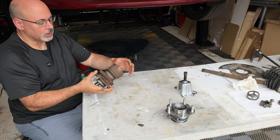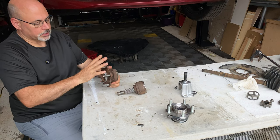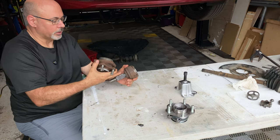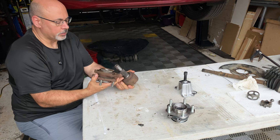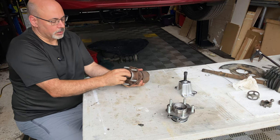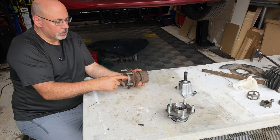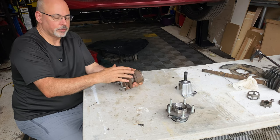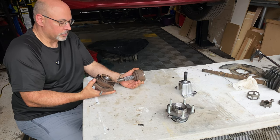This is a part I've cleaned up. The wheel bearing is fine and the CV joint is done. But the axle shaft sits in the splined hub — this is the wheel bearing your wheel is mounted to, and the axle goes through there. You can grease up these splines; that'll take up the gap for a while. I suspect the reason they put grease here is because when this is torqued down and a nut is pulling the assembly together, there's a possibility of some twist in the shaft. That lube would probably prevent wear between these two surfaces.